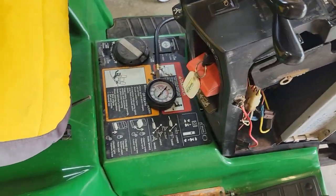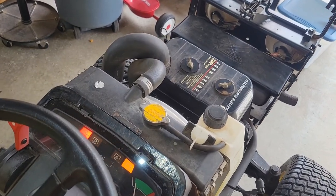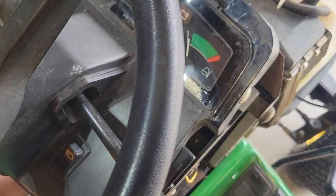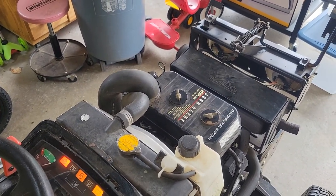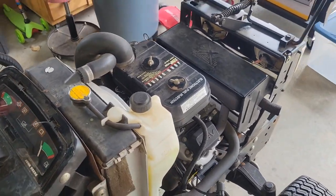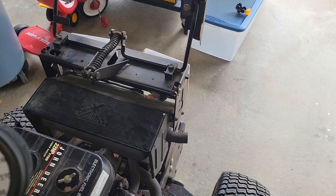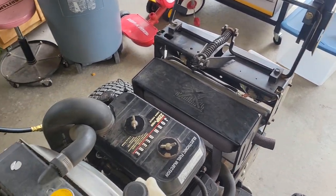We got up to about 140. Let me hit pause. We're going to go now over into cylinder 2. We are at about 140 again — at least they're even, at least they're evenly under the minimum of 170. It looks to be at about 140 on both of them, and at least they're both equal. 170 is where it should be.